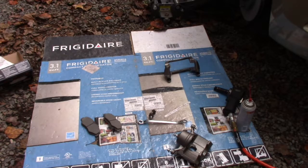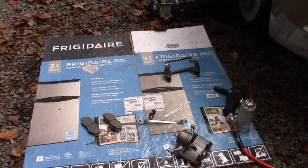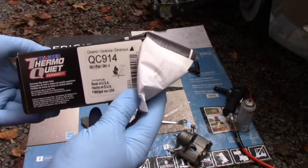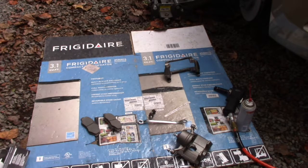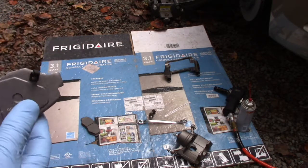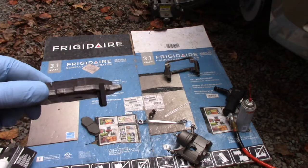Alright, let's put some pads in now. The front pads - which are different than the rear pads - I like to use the Thermo Quiets by Wagner because they're ceramic. Part number QC914. I got them from Advance Auto. I like Advance Auto because I can throw in coupon codes and get a discount. Remember that the wear indicator will go inboard - that's what I thought was the major problem to begin with, that the wear indicator was striking the rotor. I was wrong.